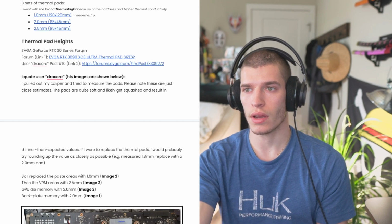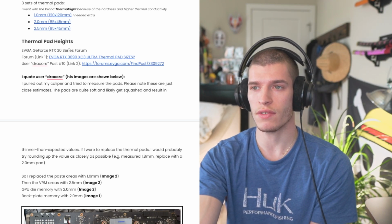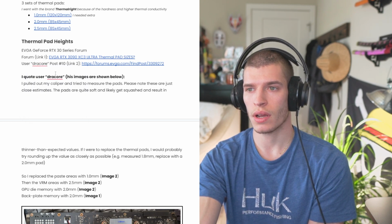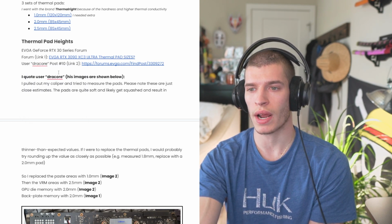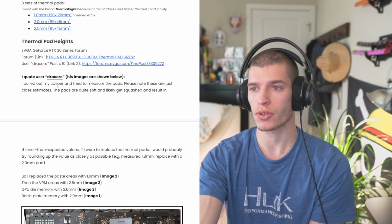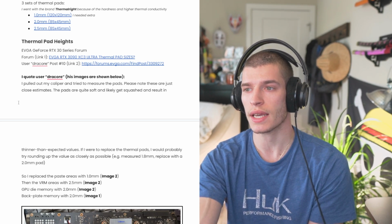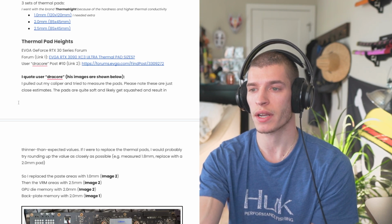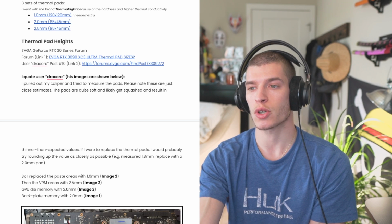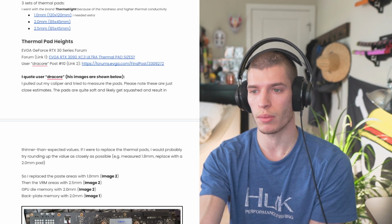And I didn't actually figure these heights out myself. I found an EVGA 3090 forum, and there was a user named Dracor, and he's the one that actually pulled out a caliper. I quoted him. I'll just read what he actually typed: "I pulled out my caliper and tried to measure the pads. Please note that these are just close estimates. The pads are quite soft and likely get squashed and result in thinner than expected values. If I were to replace the thermal pads, I would probably try rounding up the values as closely as possible. Measured 1.8mm, replaced with 2.0mm pad."